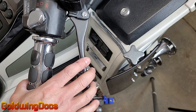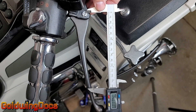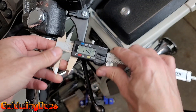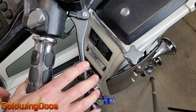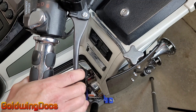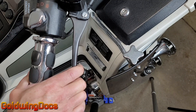Here's the secret sauce. Here's the brake lever — obviously this is a pivot and this is a lever. In the world of physics, levers perform a function. From this pivot to where my hand goes is usually about 140 millimeters. From the center of the piston to that pivot is about 23 millimeters. So because we have a lever, it gives us a mechanical advantage. If we take 140 millimeters divided by 23 millimeters, that gives us a 6 to 1 ratio. So if I apply 30 pounds of force at the 140-millimeter arm of this lever, that's actually exerting 180 pounds of pressure inward on that piston. But we're only getting started.